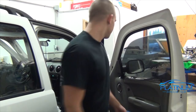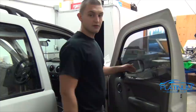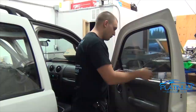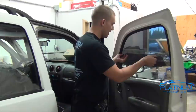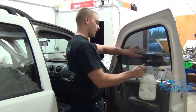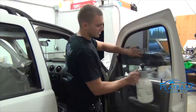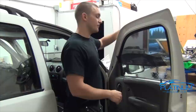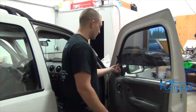If it all looks good, from there you can roll the window up. To roll the window up without ruining the door panel, spray the part where it's going to lift up, pull it away just a little bit, and then roll your window up. You want to pull the film away so that the clear release is not touching the glass anymore, and then stick the tint to the other part of the tint — fold it over. Take your spray bottle and spray any debris that could be on the glass from inside the door panel or from your clear release that touched the glass.